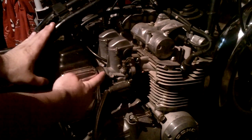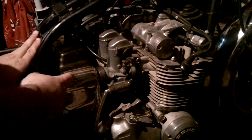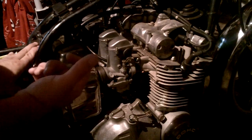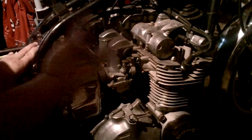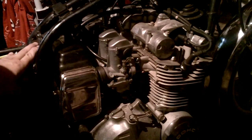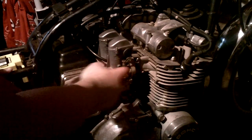There are little hose clamps on both sides which collar around both sides of the carburetors. On this bike, and I think on most older GS models, there's a little trick: the intake box you can take off without taking the carburetors off first, which makes it much easier to work on the carburetors. On a lot of older bikes you can't take the intake box off separately, and you have to fit it in with the box on, making things harder. I'm going to take the intake box off first because we can, and then take off the boots on both sides to get the carburetors.